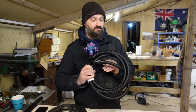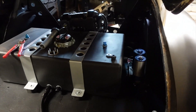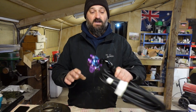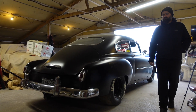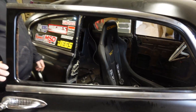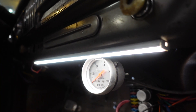Got some nice braided hose for the car — it's dash 12 from the tank to the pump, dash 10 out of the pump up to the regulator, and then we're going to run dash 8 out of the regulator to the carbs. Carbs are on their way, should have those in a couple of weeks. We've pretty much bought all the bits now — just a few little things like an engine blanket or diaper. Car's wired, still got to get a set of wheelie bars and a parachute. Waiting on the cage, then we can mount the seats and finish off the interior, get some trims made. But we're pretty much ahead of schedule — it's just killing me financially, it really is, it's getting expensive now.